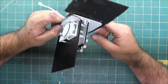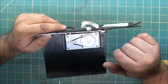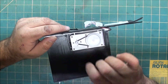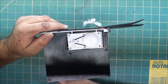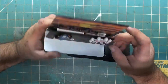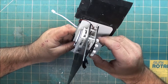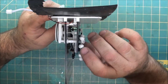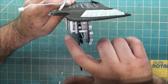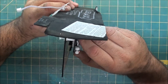One of the gears isn't spinning the rest of them, so we need to disassemble the transmission. This is where it gets tricky — you'll lose all the small parts. There is a handful of screws all the way around this; you only have to remove the six outer ones. These two attach to the motor. You can pull the motor out still attached to the assembly. If you unscrew these two screws right here, you're going to lose your motor. Not that hard to put back in, just one extra step you don't need to do. You can see that a little drive gear is turning, but this gear is not — and that's the gear that takes the motor transmission to the mechanism transmission. It's the pass-through, and it is bound up or broken. So now comes disassembly.